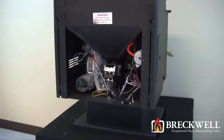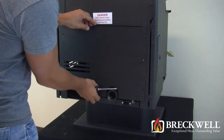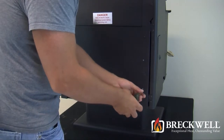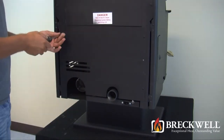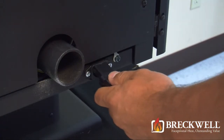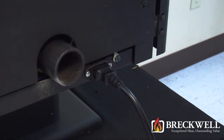To put the stove back together, simply set the back of the stove over the screws and slide it down into the slot. Then using your number two Phillips screwdriver, secure the back to the stove. Now that you've successfully completed your repair, be sure to plug your stove back in and check for proper operation.